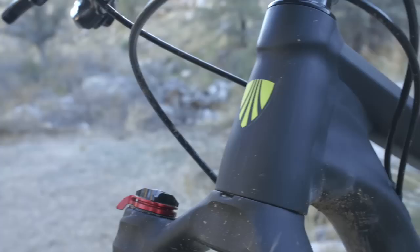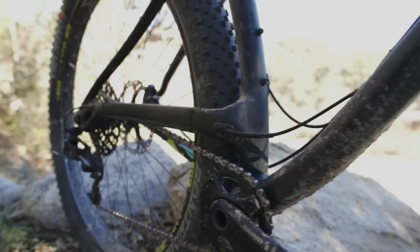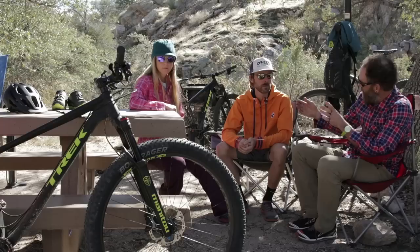The mid-stay design on this bike gives us clearance for not only the chainring and the tire, but now that we don't have to snake that chain stay around the tire and back into the frame, it's also allowed us to go to an extremely short chain stay for a bike with a tire that size.